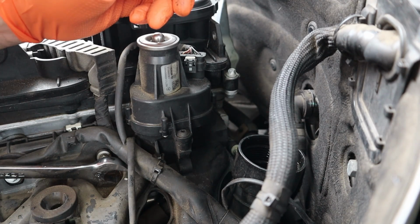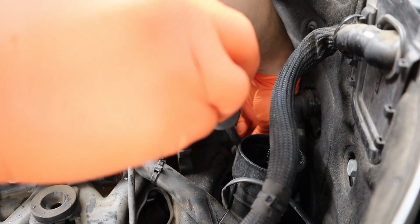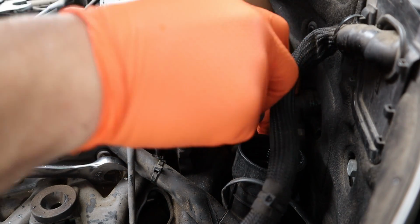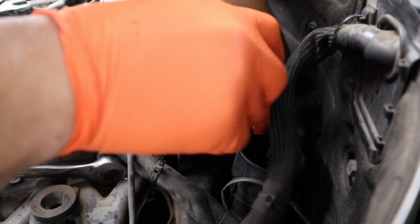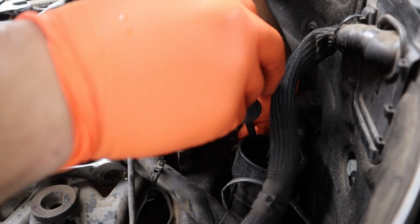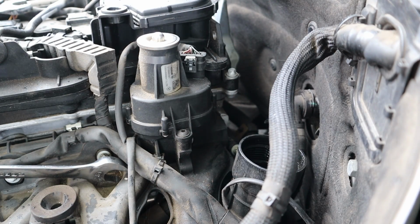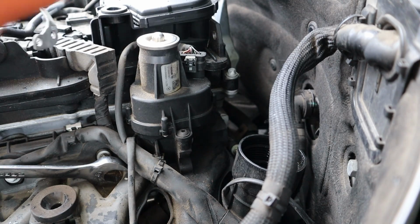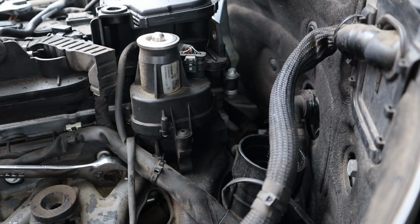Alright, so I went and got a little spring screw clamp that I'm going to slide on there now. I think the way I'm going to position it is like this. Turn it till you can just barely grab the hose, because you don't want it to be able to twist around while you're trying to tighten it with the pump on there and everything. Okay. You have to transfer this connector from your pump, so just squeeze those and slide that off.